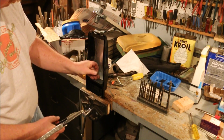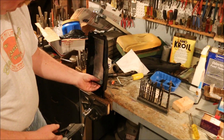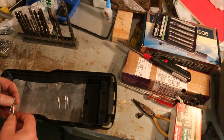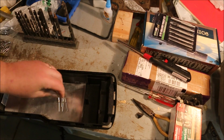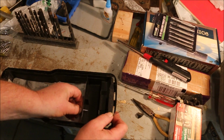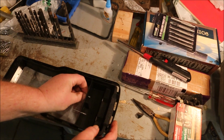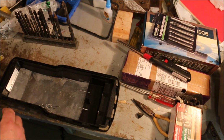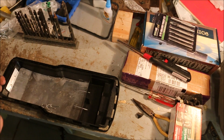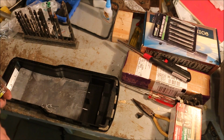Well, these rivets seem awfully long. They stick out the back a heck of a ways there. Now, these are the rivets that came with it. When I put it through, it sticks out in the back about that far. This is a rivet that I have from a kit here. These are approximately a 1/4 inch long. Got a few longer ones in there, but that's just because they got in there somehow.